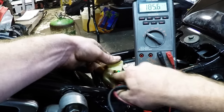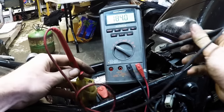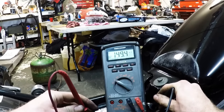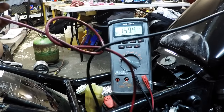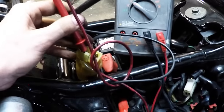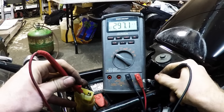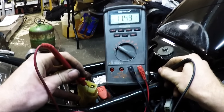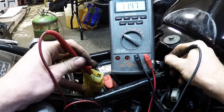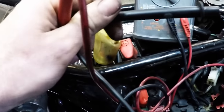The black wire is a signal wire for the transistors. I'm going to see if that has battery voltage. Positive on that terminal, go to negative — I have nothing there with the key off; the meter is just reading millivolts from the air. With the key on, putting positive to that black lead and black lead to negative — now I have battery voltage. Now the transistor is getting that signal and saying: I am ready to regulate, I am ready to make sure that no voltage is going over what it should to the battery.